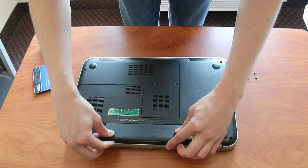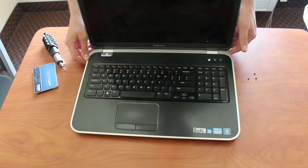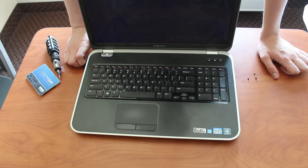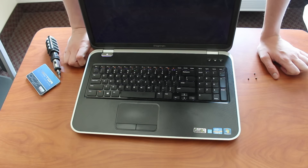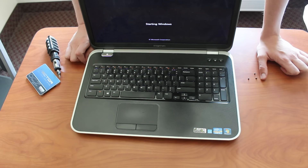You can see that the hard drive is successfully replaced. If you have a brand new hard drive, it's not going to have any operating system on it and it won't boot. But in this case, this hard drive is one I've used before, so it already has an operating system on it, and you can see that it will boot successfully into Windows. That is in general how you replace a hard drive. It's not going to be the same every time — that is just what a hard drive looks like and what you'll have to do to replace it in general. This one's a very easy one; a lot of them are very hard, especially small netbooks. But that's the basics of how to replace a hard drive.